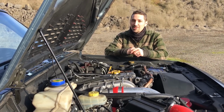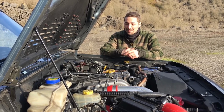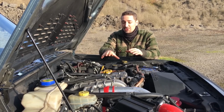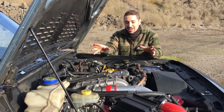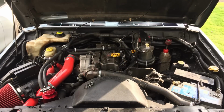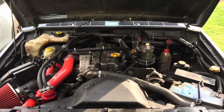It's just a lot of time and losing a lot of skin off your knuckles while you're doing it. But basically you just measure the piston protrusion, measure the liner protrusion, select your gasket. In my case it was the standard gasket because nothing had really changed. And I did that rebuild just over a year ago, and the engine's been running really, really well.